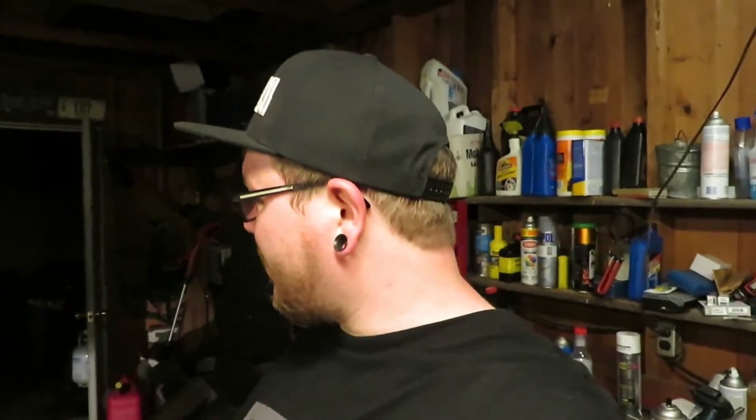Hopefully that kind of helped you out a bit. We ran into some issues. We did one thing, found this out, did another thing, found that out. So that way you guys can watch this and know what to do before you even get to it. Jake's running these are 17s, with a 215 tire. They're a plus 20 offset, plus 20 offset with a 25mm spacer. So that's how we're going to close it.